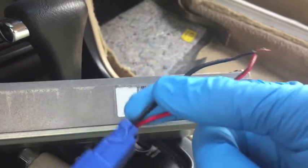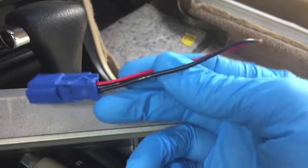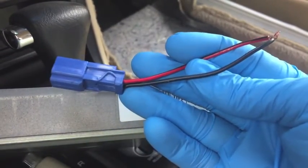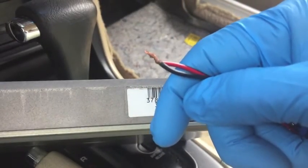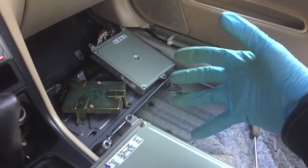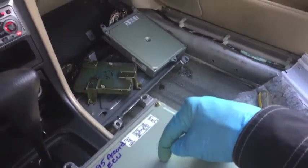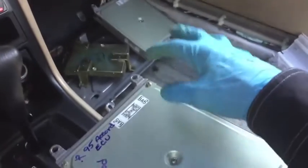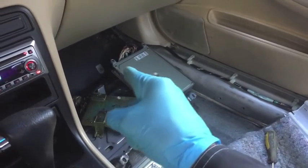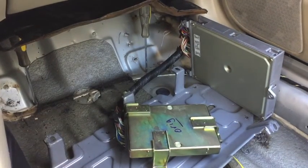His video is where I got the idea to make this. I could have used a dedicated tool that forms a loop on the OBD1 connection, but I wanted to show you how to do it with a paper clip since that's something most people have. The reason I have all this taken apart and the passenger seat out is because I have a water leak — water is getting into the passenger side floorboard. While I had access to the ECU, that's why I decided to try out this junkyard unit. By the way, that other unit is your TCU — transmission control unit. Your car has two computers: engine control unit and transmission control unit. If you don't know how to get to them, I have a video linked below. Thanks for watching.